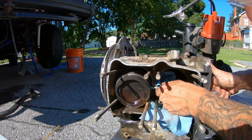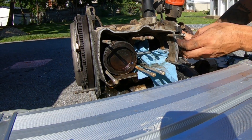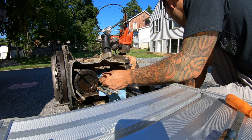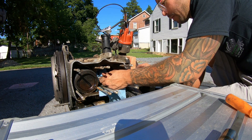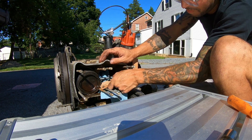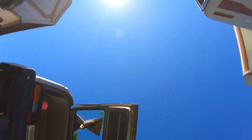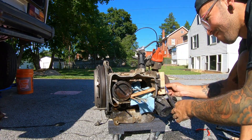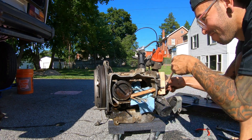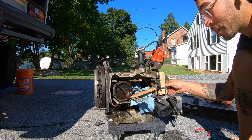I was in there with needle nose trying to grab the inside of this wrist pin and walk it out, and I don't have a slide hammer — I think that would probably work really really well. You work with what you got. This is all I got. I take my block right up against the engine, two washers just in case, and all I'm doing is just trying to brace the piston from flexing a bit. I think that'll do — blast it! Oh man, this one came out way easier. I think I just figured out the hack. I only go until I get a little bit of resistance.